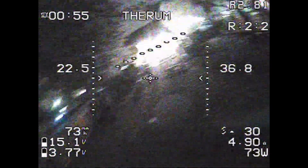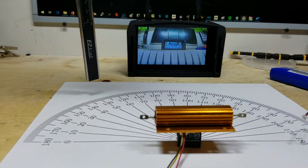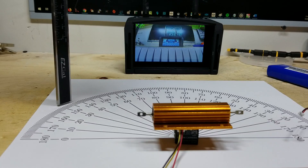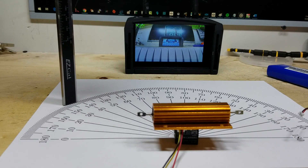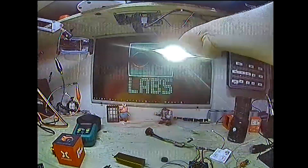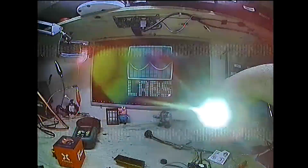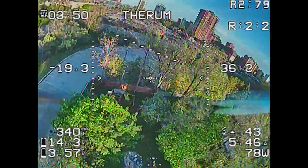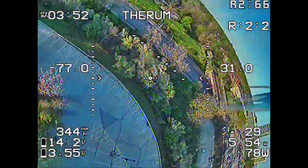This camera came with a 1.8mm lens with no advertised FOV. The FOV measured at the middle of the frame came in at 112 degrees, and at the upper corners at 140 degrees. Switching to 4:3, the FOV increased by only 2 degrees. For the wide dynamic range sun test, I put my small 900-lumen flashlight at a distance equivalent to how large the sun would appear on camera. Outside of a lens flare and bright halo around the light source, the rest of the bench is clearly visible.